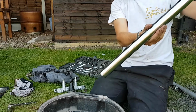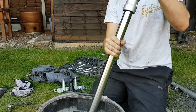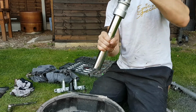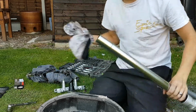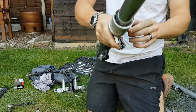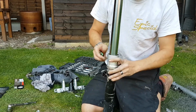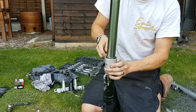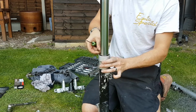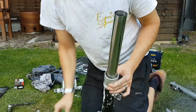Right, you want to empty the oil out. That's most of it. Wipe the excess off with some old pants. Move your bucket out of the way for the time being. So the next thing, inside there is a circlip. With a small screwdriver or an actual pick, lever out the circlip. It's quite an easy one to get at. They've shaped it nicely. So that's the circlip. Make sure you put everything sort of in an order you can remember.